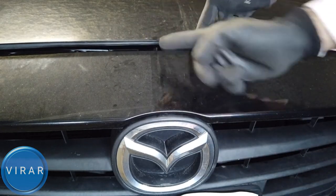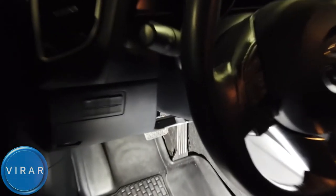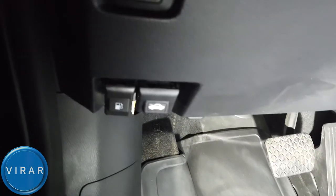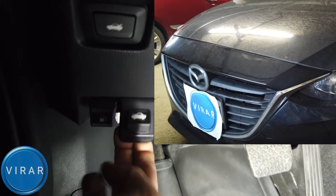In this video, I'm going to show you how to open up the hood of your 2014 to 2018 Mazda 3. So let's get started. Open the driver's side door. Right where the driver's left foot would go, there's the primary hood release lever — it even has a sticker on it. That's the one right there. Just grab it and pull it lightly.